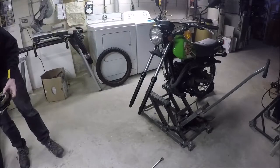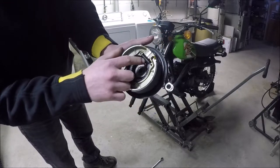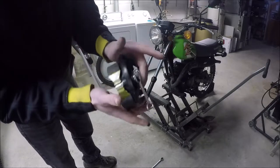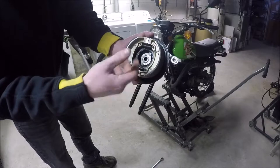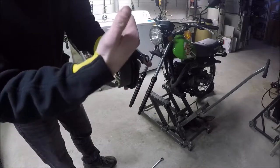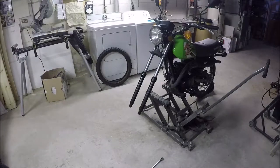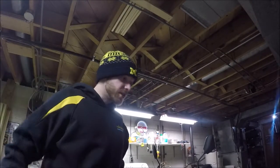These are new shoes — incredibly easy to put in. You should take the two springs off. This is your speedometer and it rides on a little worm gear. That's what's spinning where your speedometer threads into and that gives you your speed. This can come out — it's just being held in by the grease. All you do is put these new shoes in, lube up the cam, and make sure not to get grease on the sides of these. I roughed these up with sandpaper and blasted them off with brake clean, just trying to get a little more stopping power in them.